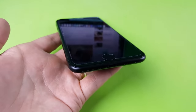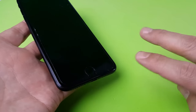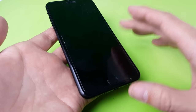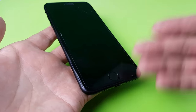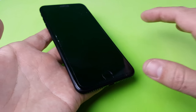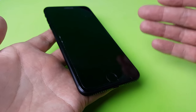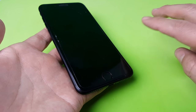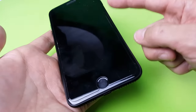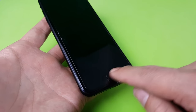Now I'm going to show you how to revive this phone. If you're familiar with previous iPhones, there was a two-key combination to revive the phone. This is very common — all my iPhones have had these black screen issues. The only thing is the iPhone 7 uses a different key combination. If you have an iPhone 6 or prior, the two-key combination was pressing down the home button and the power button simultaneously.